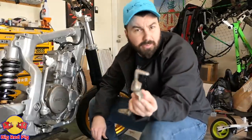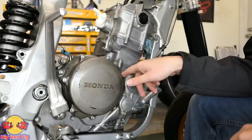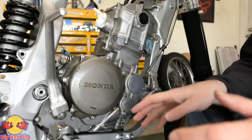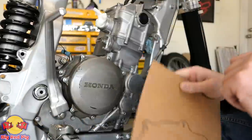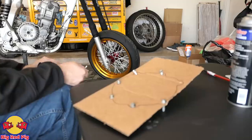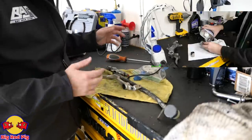Now let's do the rear. Of course, it just dawned on me — when I go to put this brake lever back on, I'm going to be somewhat in the way of this cover. Here we have this pretty one to put on — Kodad sent this to me. I got one for the other side and one for a cover here. Good chance these are all kinds of different lengths, so you need to make sure you're not going to get them out of order. What I normally do is pick the most top bolt, go in clockwise order and set them below me. We've got a little sticker here that says rear caliper, so we know that needs to go here. In a previous episode, we tore apart the rear brake caliper, cleaned it all up, and we're going to try to do the same thing to this.